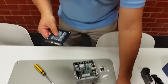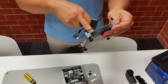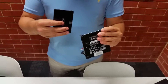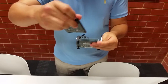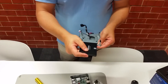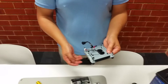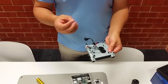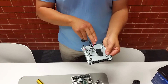These SATA connections must line up with the corresponding SATA connections at the back of the case cover. Make sure you are lining up correctly — in this case it's in this orientation. Slide it in and push it until it clicks. When it clicks, it means those contacts are actually connecting to the SATA connections.